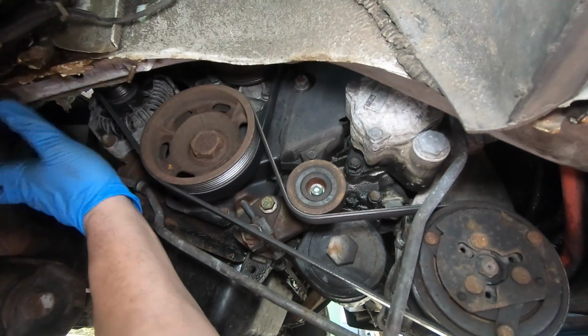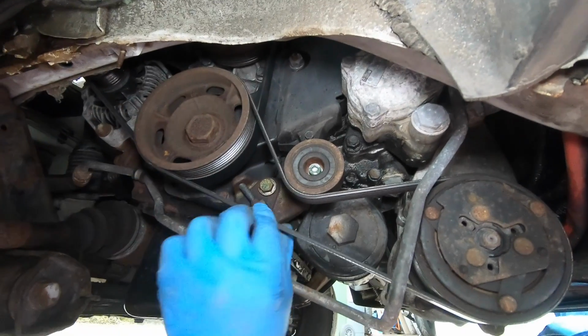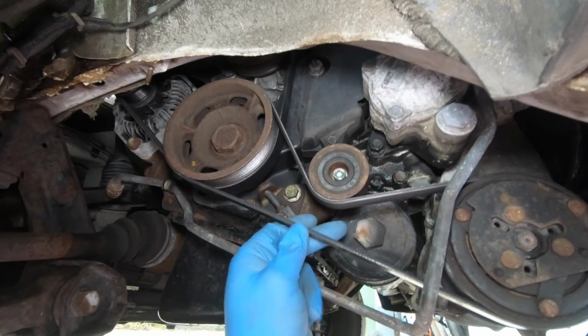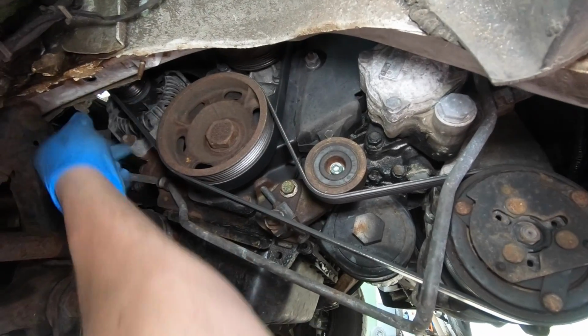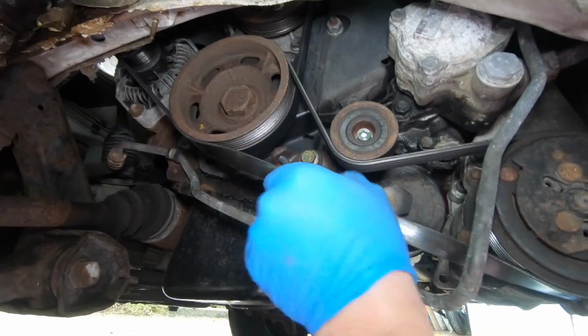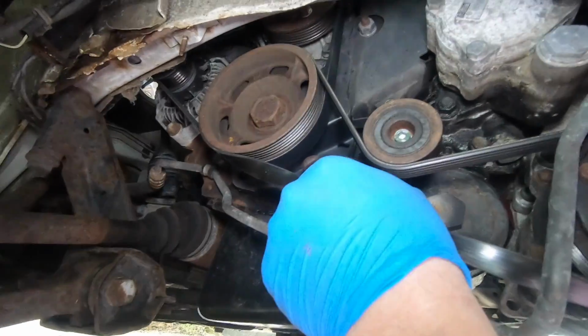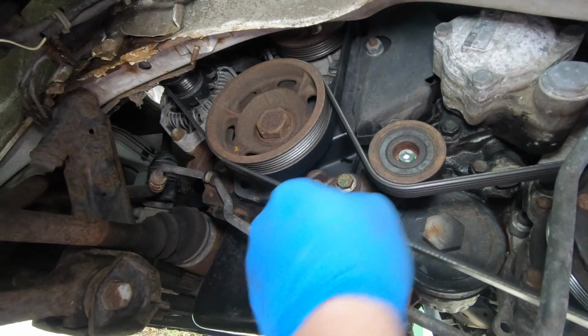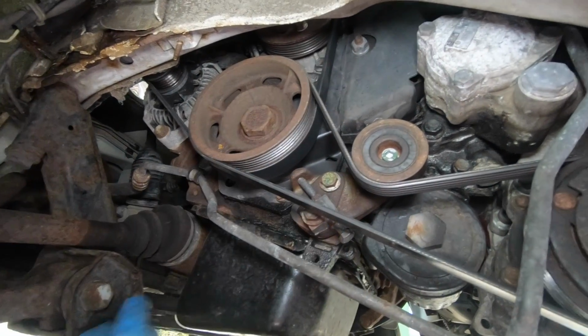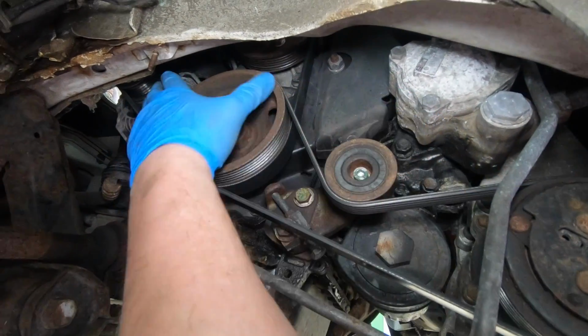Yeah, all good. Springs back 90 degrees and comes back again. Lovely. Could that be too tight? Have we done it too tight? No, that's lovely. That's really nice. But that one, look, I can turn it right round. You see the difference? That one can go right round, almost 180 degrees. So he's too loose, and he's got to be tightened up. So that's the auxiliary belt. They're both auxiliary belts. They run the auxiliaries to the engine.